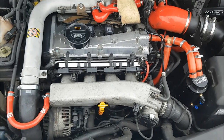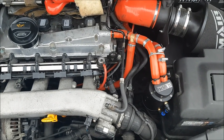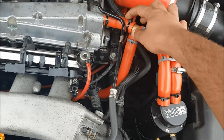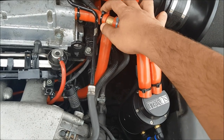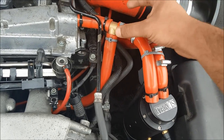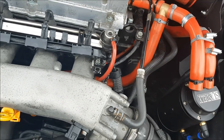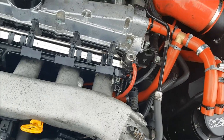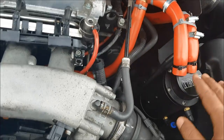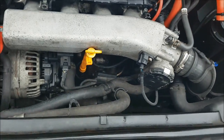What's going on YouTube? This is RedlineRevs. A quick little video on how I did my oil catch can mod and PCV delete. My PCV system was leaking around the piping that leads to that hockey puck accumulator valve, and it was causing it to lose power and also the smell of fumes coming into the cabin. So I've replaced that with an oil catch can, and this is how I did it.